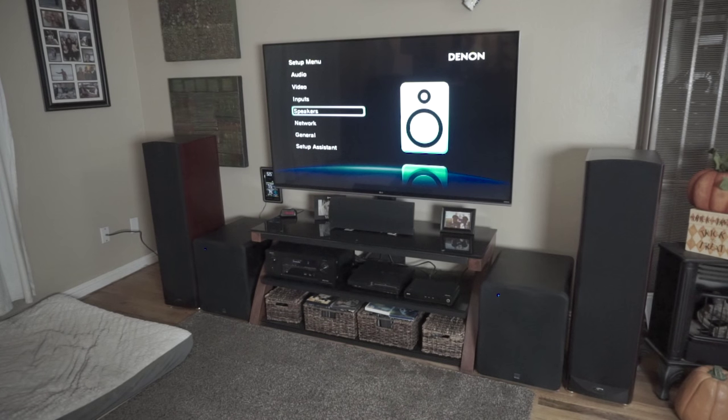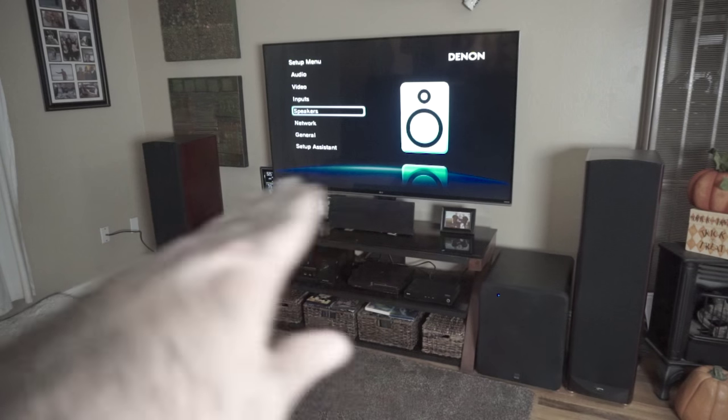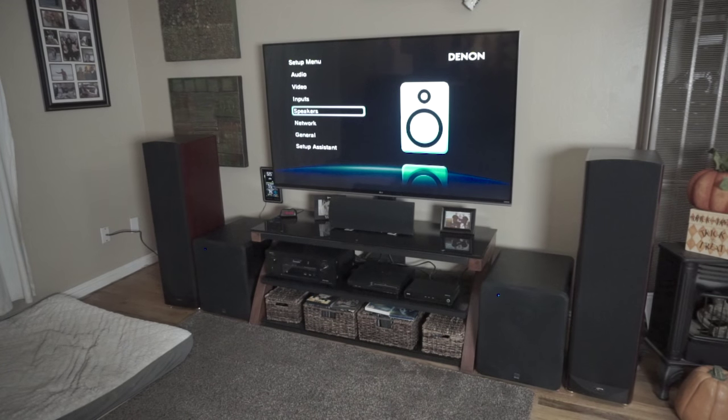Turn it up to about halfway, or depending on what the manufacturer says. If you've got something with variable settings, follow the manufacturer instructions — this is broad advice that should apply to all subs. If you're paying attention, you've got two subs. When you set them up, you want one on either side. Don't group them together — you're kind of losing the effect. Having them separated, or non-co-located, is the name of the game.